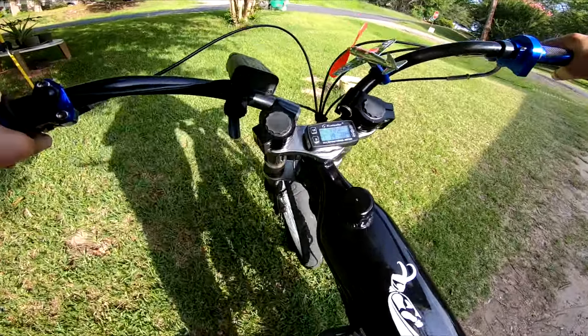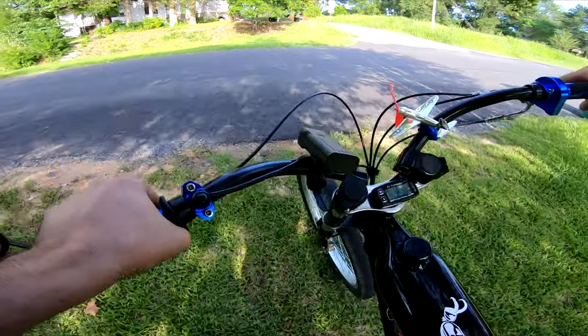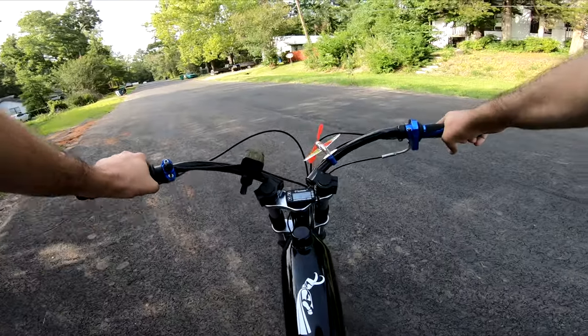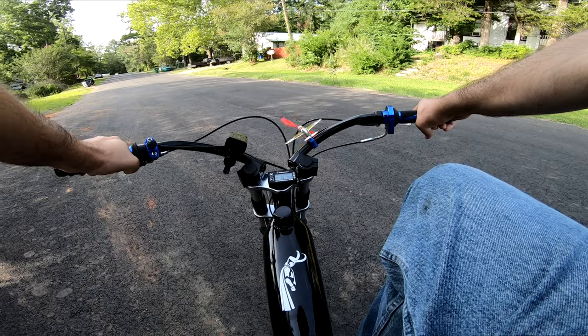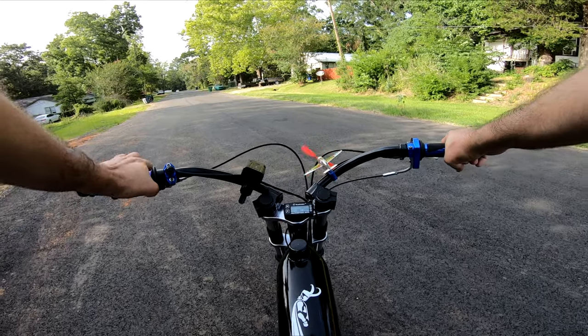It's rather embarrassing to admit defeat to a Bikeberry product, but I'm not claiming it's a bad ignition system. Throttle response and power always felt good, and it always looked like I had a strong spark with this system. My best guess is that the Bikeberry ignition system has a pre-retarded ignition curve, which might be good in a lot of situations, but you may need to play with the magnet to get a good idle.